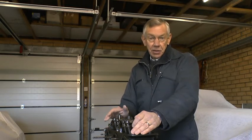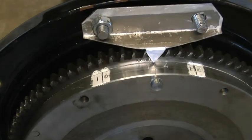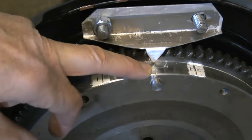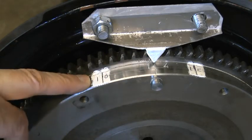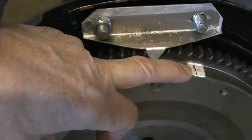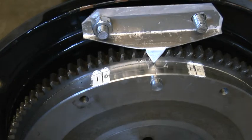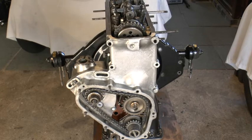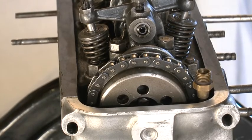I've always found this method to be the most accurate. Obviously having the engine out of the car makes the job a whole lot easier, and without the gearbox you can easily see the top dead center mark and the additional marks that I've added to show the inlet open position and the exhaust closing position. These vary slightly depending on the engine being a Le Mans or a sports, but the exact data is given in the Singer manual. I would just stress that this is setting the valve timing on a new build engine, so at this stage the top timing chain is not in position and the crankshaft is not yet connected to the camshaft.